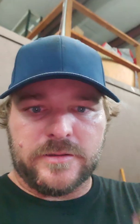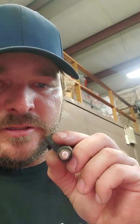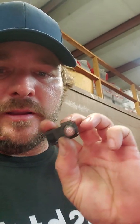And it literally — on the GM side, these have been known to — you can decap a GM injector and get it to flow basically almost double what it would typically flow with the nozzle on there. The spray pattern is garbage on it, but again, this is basically what was happening to this injector. You're basically doubling to tripling the output of this injector by that cap or that end piece being missing.